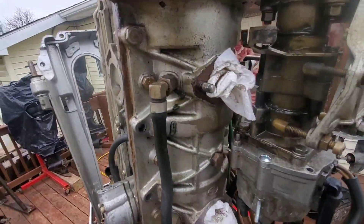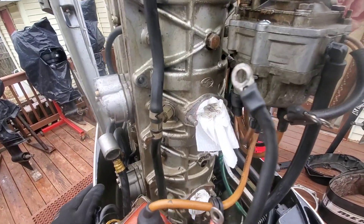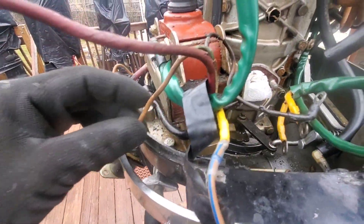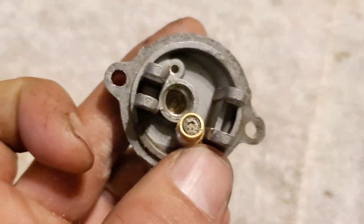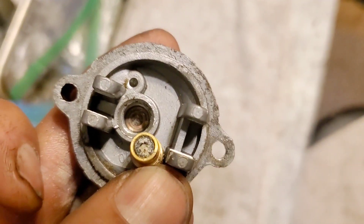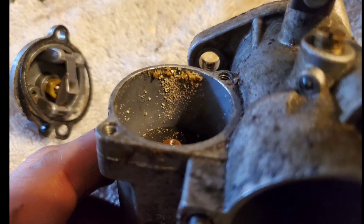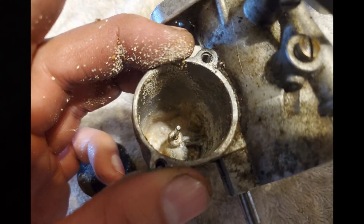Carbs are completely pulled. I'm going to go ahead and soak them overnight and then rebuild them with all new gaskets — this thing should be running just like brand new. I'm probably going to redo some of these wires here. I already did the choke wire. These passages right here are completely, completely clogged — there's nothing getting through there. The carbs are pretty messed up: a lot of dirt, sand, grime. The tangs are off, definitely set too low. You hate to see that.